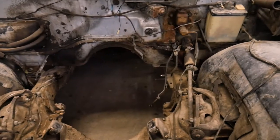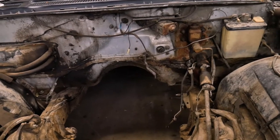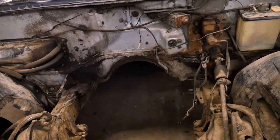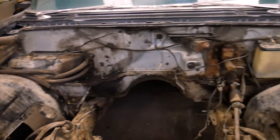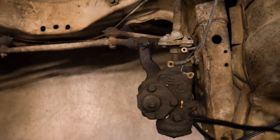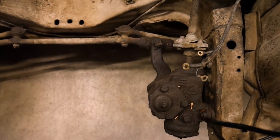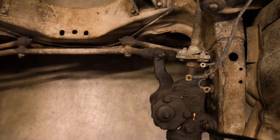And I have a couple different degreasers. I'm thinking about testing them out over this engine bay. Then we'll rinse it off with water. And I also have a hot water pressure washer that I'll use afterwards to make sure that there is no chemical residue before we go back with paint. And even though I'm replacing it, I'm also gonna degrease the steering gear, because I don't know when I'm gonna have my new gear. I don't want that greasy piece sitting there, because every time I brush up against it, I'll get grease on my hands and arms.